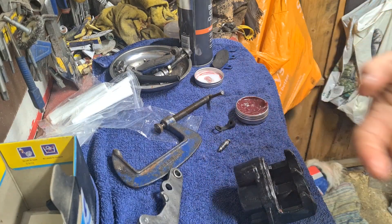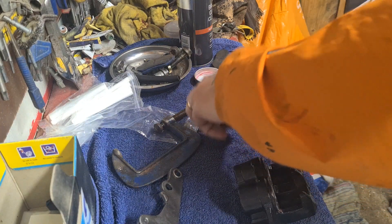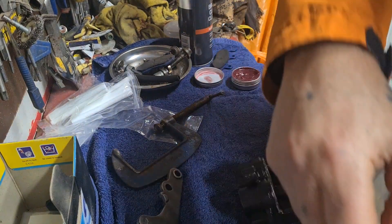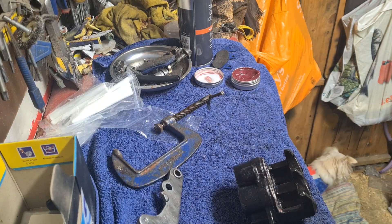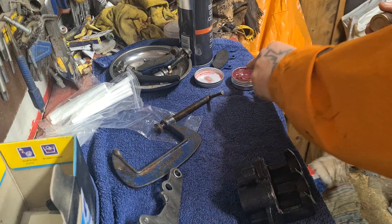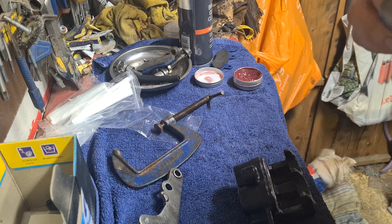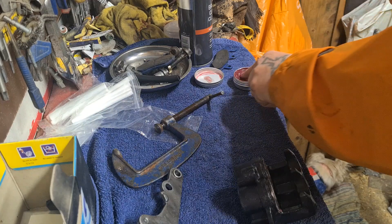So anyway, that's that bit done. Just wipe some grease off the fingers. So next job is to put the pistons in, and this is a bit of an awkward one. What I do — I'm not sure whether you should be putting a bit of grease on here, but as long as there's no grease on the back where the oil will push the piston out.